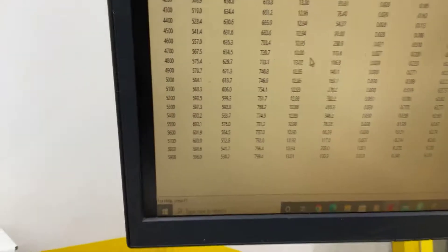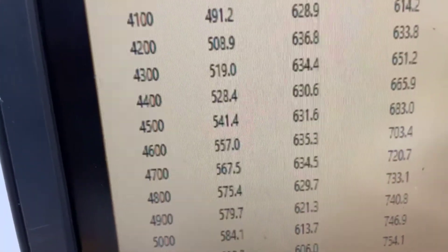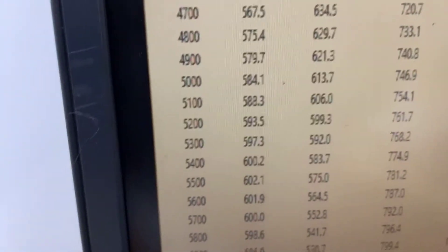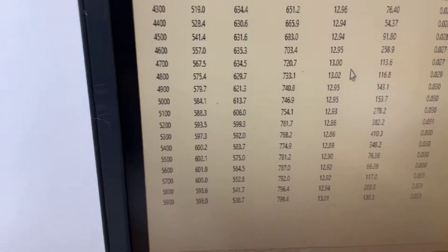Let me show you how it ran. At 3,500 RPM it makes 614 foot-pounds of torque, peak is 636 foot-pounds — really flat in there. Makes 602 horsepower. Everything looks good, get her off there, we'll wait for you guys to pick it up. Have a great day.